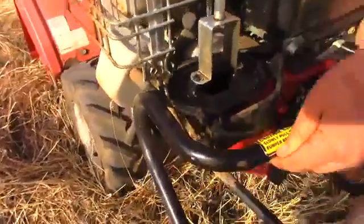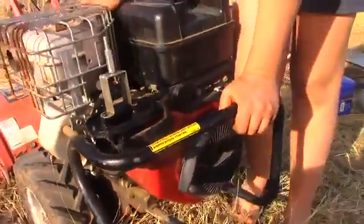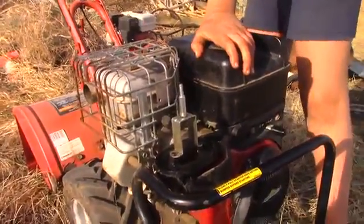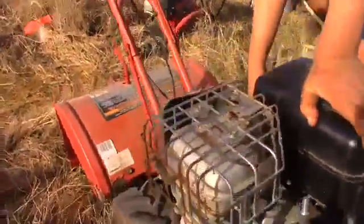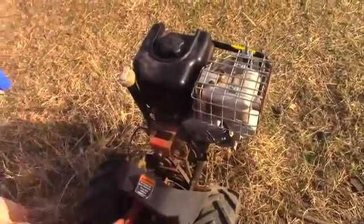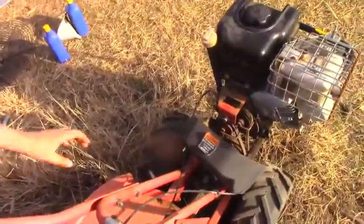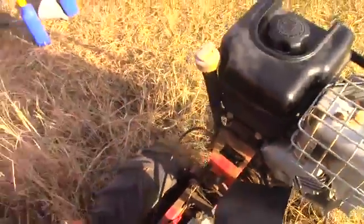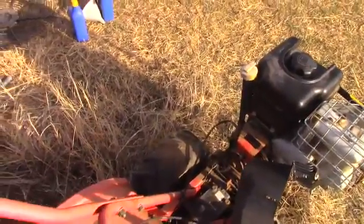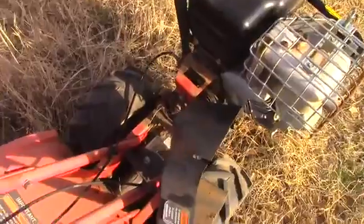Okay, let's see. What else are we going to need? It looks like if we clean that carburetor up. Now, you said the shift cable is no good? Yeah, the drive cable here. It's supposed to move this pulley right here, and the pulley's free to tighten the belt and make it drive. But if you pull on the cable, it doesn't move that pulley. Look here, that's no good right there even. With this cable here, it works that one. Oh, so it's the other cable. It's a bottom cable down there.